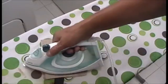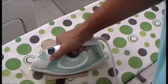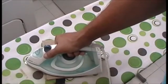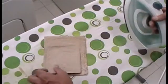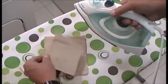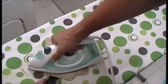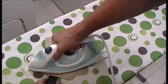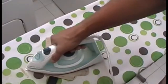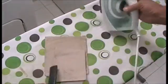Now, let's go ahead and use this other piece of cardboard and let that heat really sink in. And you can iron back for it all you want, it's not going to do anything for it. The main thing is getting that set and heat in. Now flip it. Drop the cardboard back down. And let that heat get at it. You're going to do this about 2 or 3 times, okay? We're going to stop, and then I'm going to go rinse it off with some cold water. Make sure you get some cold water on your hands first, because that rubber is going to be hot. When you run it under the cold water, you're going to run it up and down like that to keep that set in.